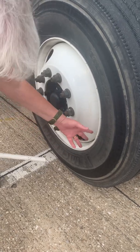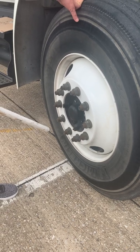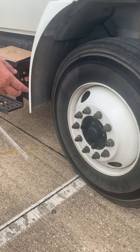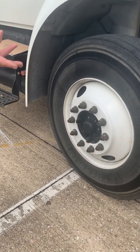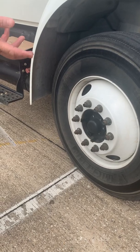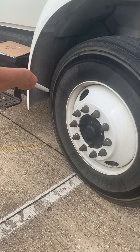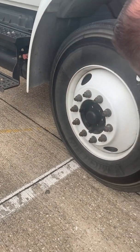And this is where I would check the pressure of my tire to see that it has an adequate amount of air pressure. And what is the amount of air it's supposed to have in it? That's the biggest question I have. Okay, on the bus tires, it's in between 100 and 105. They normally run them at 100. It'll say somewhere here as far as what the pressure should be. That's one thing I never was able to figure out.